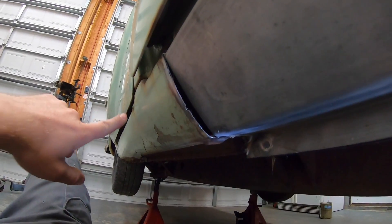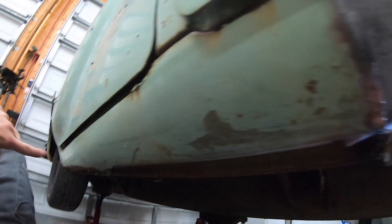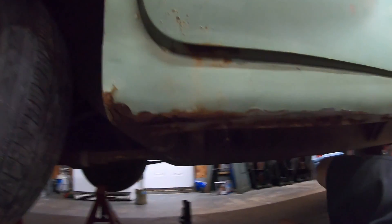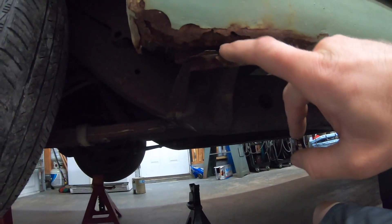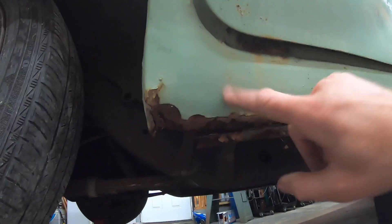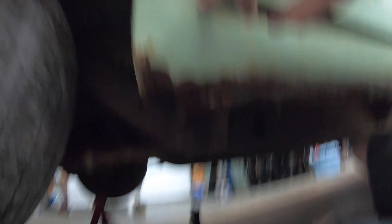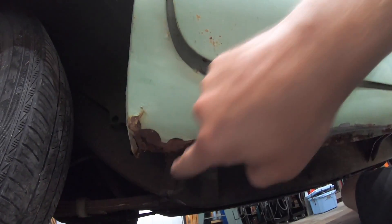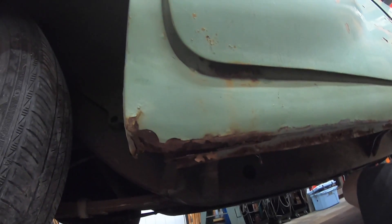So the plan is going to be to replace my rear door rocker piece. This is still solid, so I hate to cut it out, but what I'm going to have to do is come along this edge, cut it out, come along the bottom edge, cut it out, and put another piece in so that the rocker is uniform the whole way down the car. The other issue is when I get back here, because this has been fixed before - it's all rotten and nasty. Someone took a piece of sheet metal and just bent it and welded it in the best they could, and it's full of Bondo and all sorts of other stuff. I'm going to come to here, cut straight across, and then fabricate this piece back here because the rocker actually stops way up here.